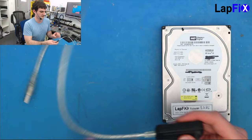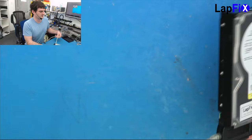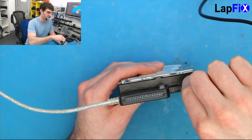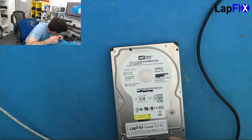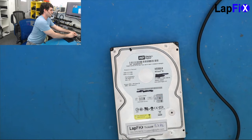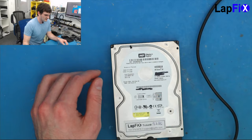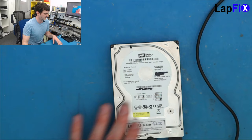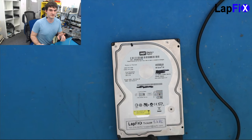Now let's try this and see if it does anything. We're going to plug in our IDE connection and then plug in our Molex — the power. Right when I plug this in, I expect it to at least spin. I'm going to put my mic next to it so you can hear it — it is spinning. Let's try connecting it to the computer and see if it comes up. You can feel a little vibration with your hand if you can't hear it. I did check — it doesn't look like it's coming up on my computer at all. It's just spinning. Good thing: we got the power on. Bad thing: we still can't get the data.